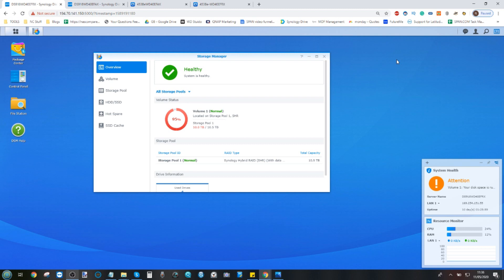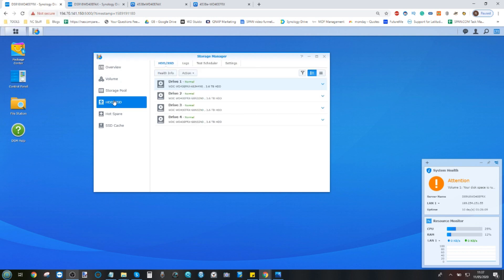In today's video we're looking at four NAS drives. The first NAS is a Synology 918 populated with a mixed array — a combination of RX older generation WD Red 4TBs and one WD AX drive, which is the newer generation WD Red featuring drive-managed shingled magnetic recording. Although we're running four NAS units, we're not really comparing them directly; we'll use all of them as isolated examples.